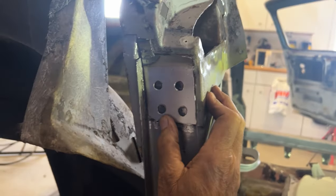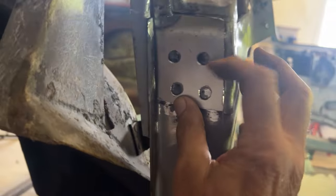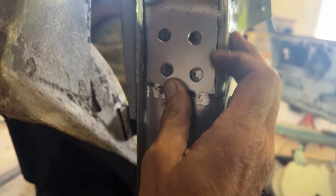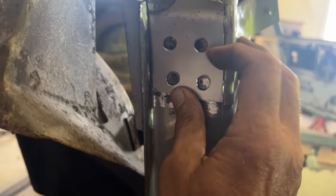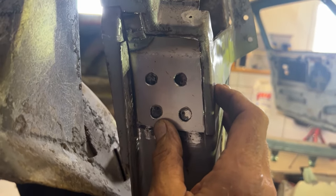I made the piece that goes here on the side. Drilled my holes for my spot welds — you can see here. I'll weld that in and then blend all the welds in. I'm going to go ahead and mark where the spot welds are and then clean the metal up underneath to make sure I get a good bond, a good weld. Then we'll go weld this in.